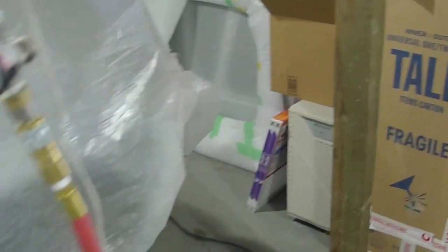I've taken the roof and the rear quarters, 2000-grit sanded them and put them back down because I'm going to respray due to the sanding scratches in them. All these other panels tucked in the corner are all good — they're all fine and I'm not going to redo those.